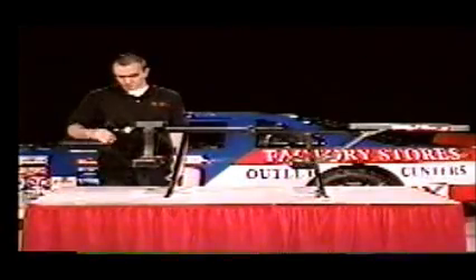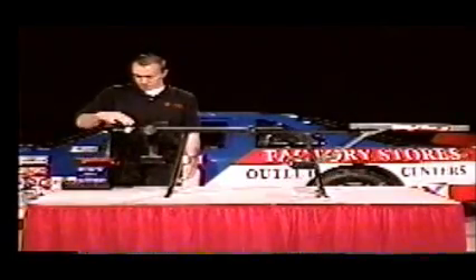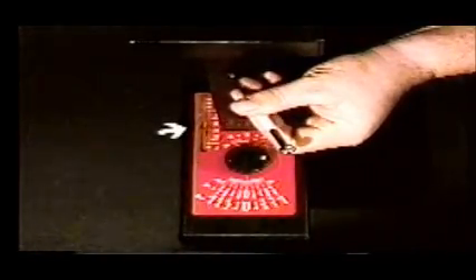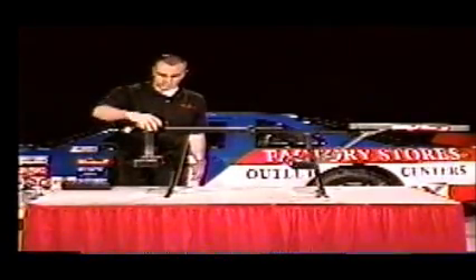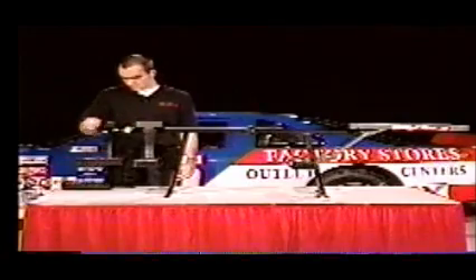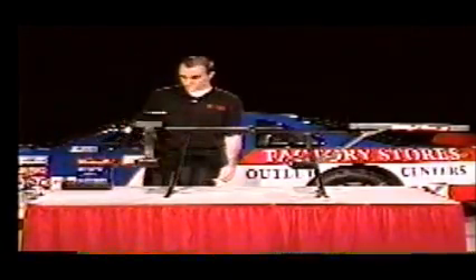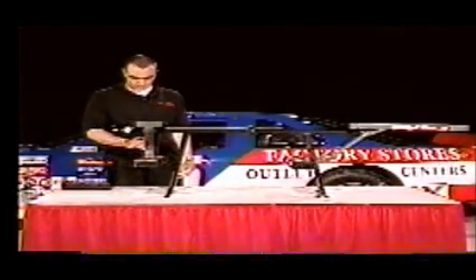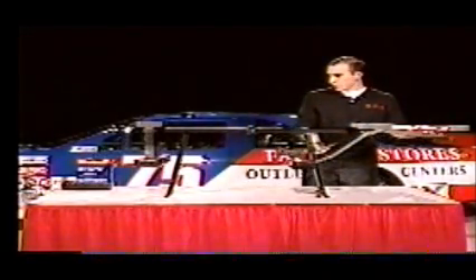The technician then places a combination gauge on the balance disc and repeats the camber zeroing procedure for each of the combination gauges. After completing this procedure, the technician places the combination gauges on the discs next to the mirror bar with mirrors facing away from the mirror bar. The technician verifies that the camber scales on the combination gauges read equal and opposite. The technician then turns on one of the laser guns and raises it until the laser points to the mirror bar located at the end of the calibration bar.